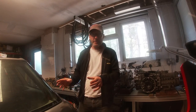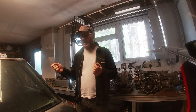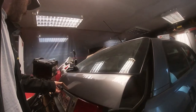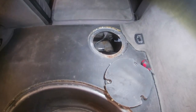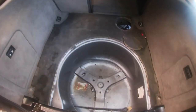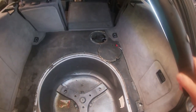That's the tub over there which is going to fit underneath. Thinking about it overnight — the petrol tank in this was held in by two straps which went around and bolted up into the chassis rails. I think we'll be able to do the same with this, which will make putting it in and taking it out very easy. In the boot, the packs will come up around this area and I'll be able to put a point here just to access the positive and negative terminal — have a high voltage junction box, battery disconnect, perhaps the charger back here as well. There's plenty of room to play with.